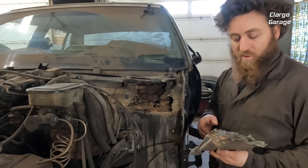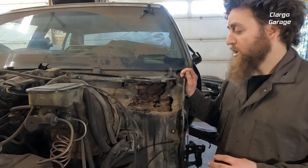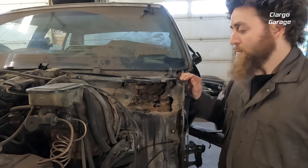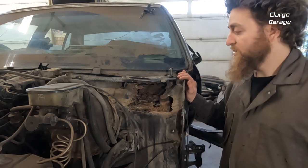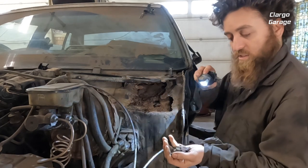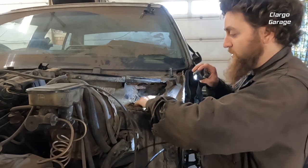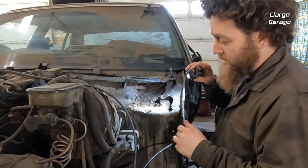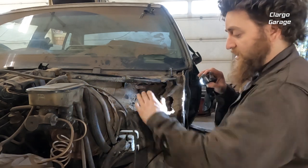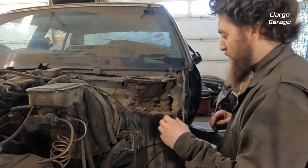There's even some wire mesh in here. So even though that wasn't a proper fix, there's quite a bit of bondo, so it probably didn't make it any worse — it might have helped give the car a little more life and longevity. So maybe it wasn't all bad. If you look in here it's all rust, and what's holding the rust is some factory soundproofing. You can actually see some wires through there, and there's a catch drain here, so as water collects it directs the water to run down.